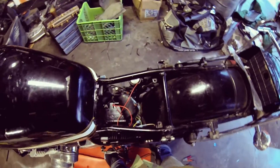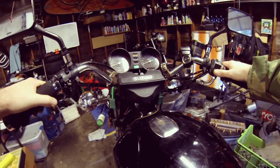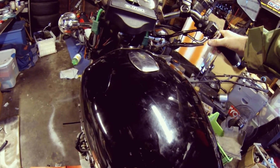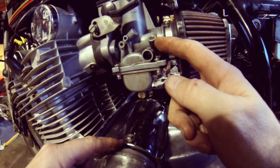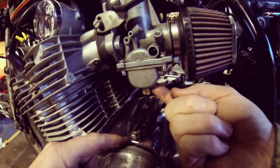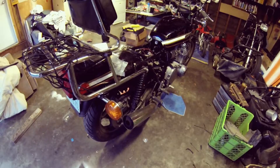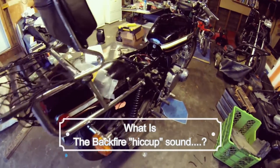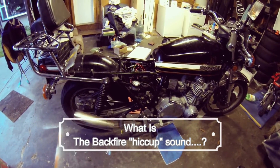Let's try this thing — let's see if it starts. Lights turn on! All right. I'm at two turns out on each screw on the air pilot and three-quarters to seven-eighths turn on the fuel pilot. I'm not going to mess with these again but I'll tune these up later once I actually do a carb sync. It's got that Kerker exhaust — you hear it backfiring a little bit. That backfire I'm not too sure what is. I don't know if you guys on GS Resources want to help me out with that one.